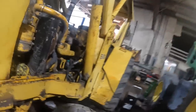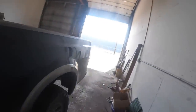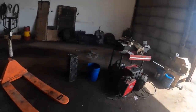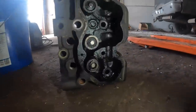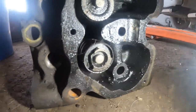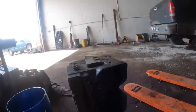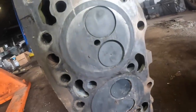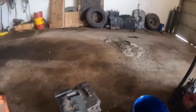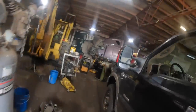When I tore this engine apart, let's go over here and show you this cylinder head so I can more clearly explain what I found. Here's the old cylinder head right here. Down here on this valve — look at that retainer. That was like that when I tore it apart. Look at the valves recessed back into the head. That is one worn out son of a bitch right there. I just said if you can find me another head, get me another head.